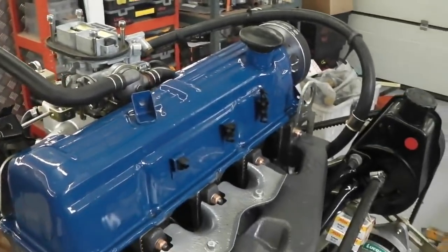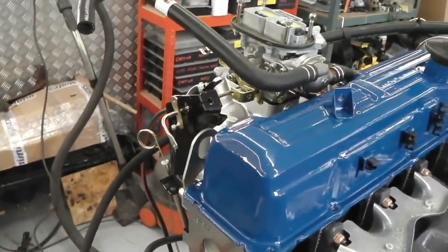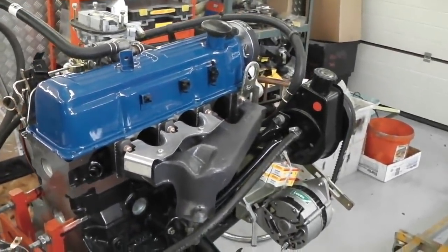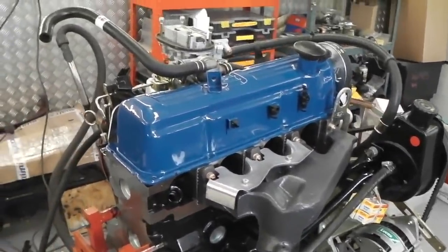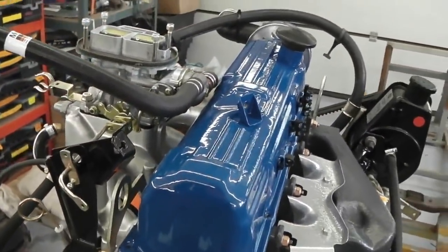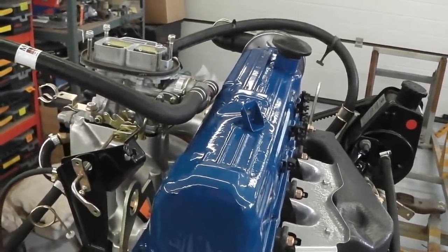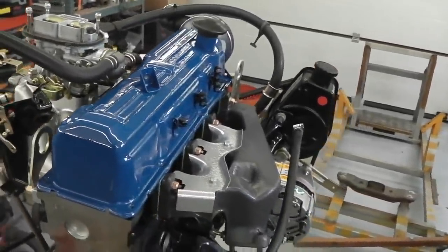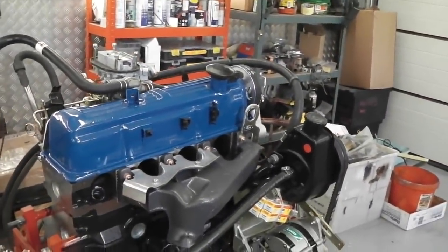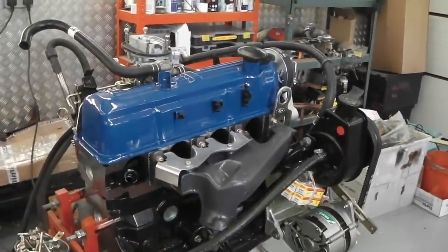We also need to finalise the spray bar, because it may or may not have a small rubber eyelet washer on the spray bar centre fixing point. I need to confirm that. I've been going on about that for a while now, so it's time to go and look at an engine that's not been messed with and see if the spray bar comes off with a little rubber O-ring. If it does, I'm missing them and I'll have to borrow it off that engine. I've got a spare engine in the wings, a 1600 engine, which was destined to go into Bramble, the TC estate car.